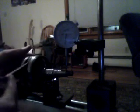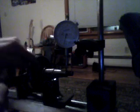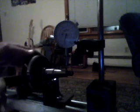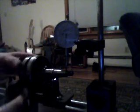Well, that's the lowest now, which means, I'll tell you what that means, is that I actually hit it too hard. So now I've gone too far. This is now the highest, the pin towards me, which was just the lowest. Now this is 1 1/2. And that is -1. So now because that's the lowest, I'm going to take it out, hold the flywheel, hit it far less now, because apparently this crank moves pretty easily.